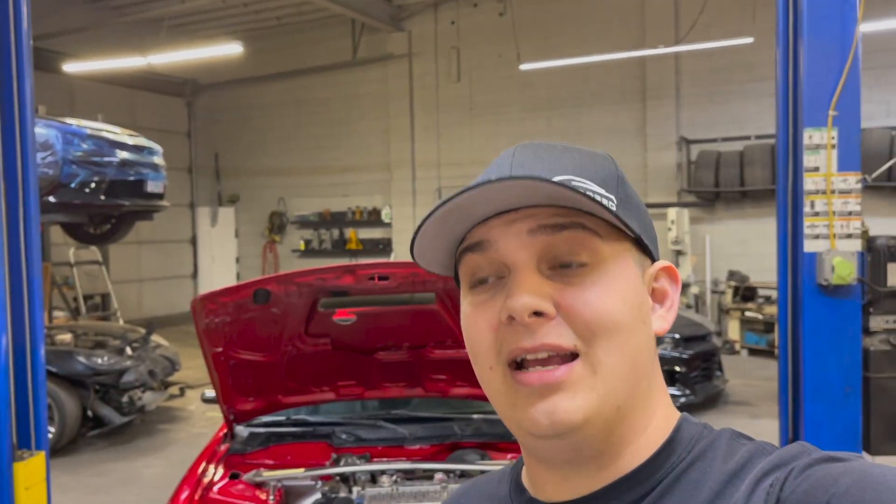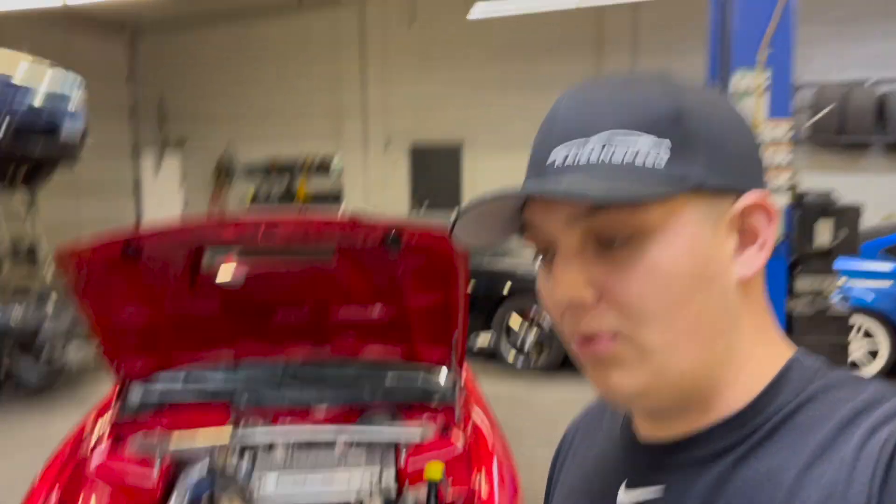It kind of mimics dry ice in a way. Donut Media actually has a really good video explaining methanol injection, and I'll put the link down below so you guys can watch that clip and understand why I'm doing it. For the most part, the main goal is it's a fuel supply — it's a really strong fuel. I believe it's equivalent to a C16. So it's going to allow me to run high horsepower without knocking, rather than just trying to tune the car on pump gas where Hondas usually start knocking around 470–480, and you start taking timing out. It's a knock reducer, it's a stronger fuel, and it has cooling chemical compounds in it so your engine has fresh air.